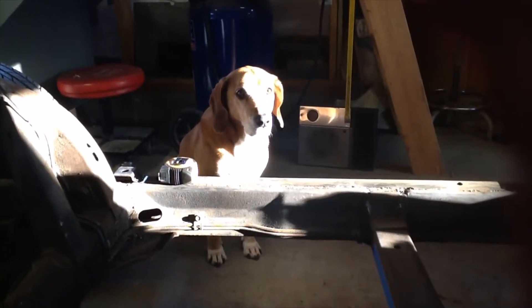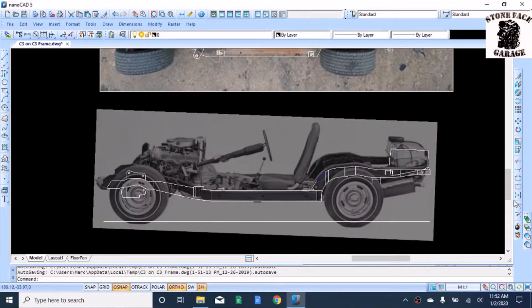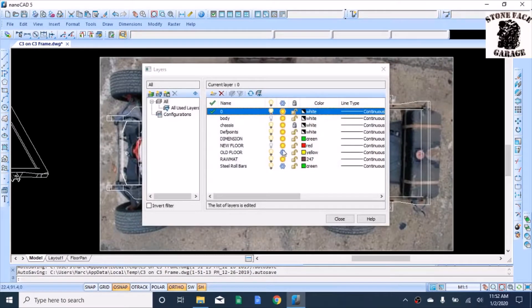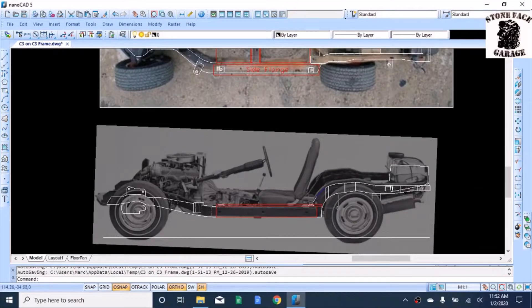In this part of the video, I'm going to go through how I planned and designed the new floor for the Corvette chassis. Here you see the overhead view of the chassis. We're trying to accomplish recessing the floor pan down between the frame rails to gain some head height in the finished car and get the seat down a little bit lower. The new floor outline would have floor pans recessed down with some bracing to hold it on the chassis and clearance around the crossmember.